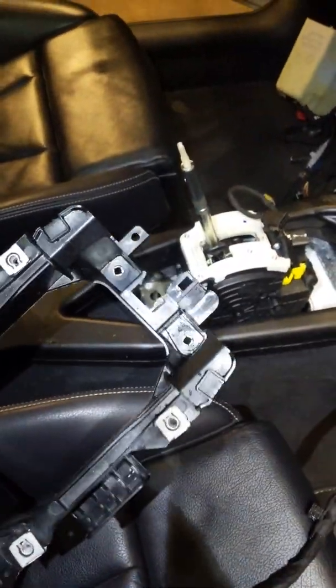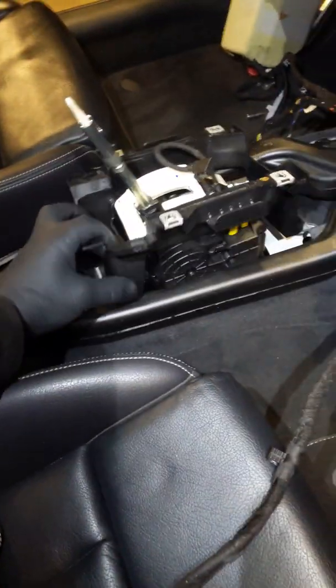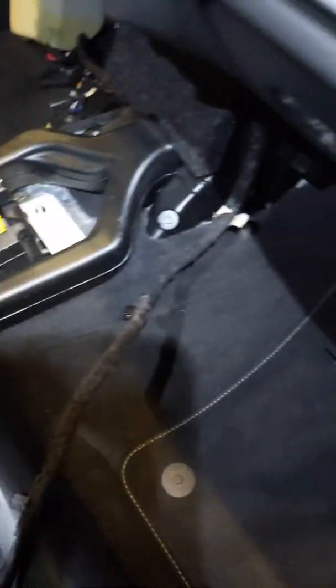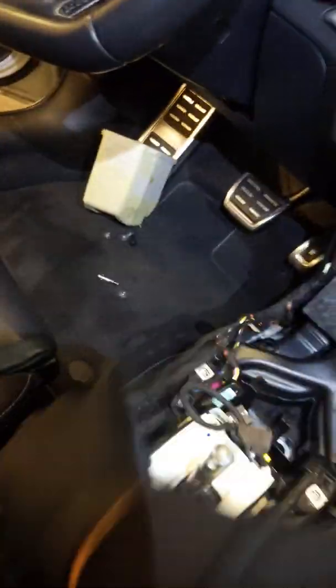That's it — it's pretty easy actually. Once everything is out, this is what it looks like. You're going to have this piece here — this is what sends air to the back, it just slides back in here. Then you've got one of these plastic things that holds everything together, that sits here. Those four bolts hold your shifter assembly in place, and then you've got your wires clipped onto it — same thing with this side. You'll see once you get it all apart, and this piece sits in here.